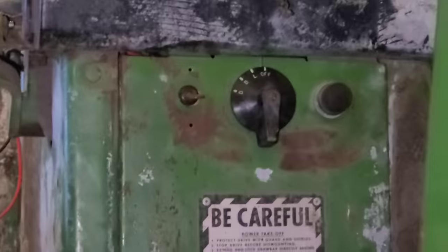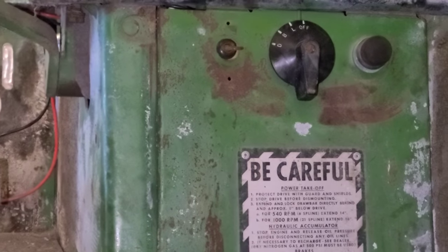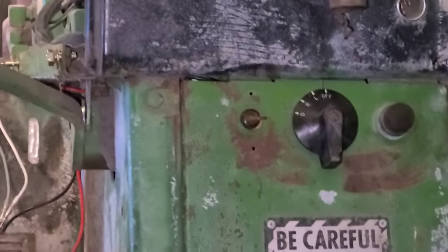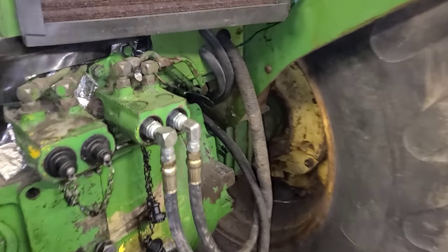So he put a toggle switch on the dash there, and that is what excites, because the alternator needs to be on a switched power, right? So, sorry, instead of having a key, you flick your alternator on and start it with the button. A little bit cheaper and easier than wiring up a key in there for him for no real reason.